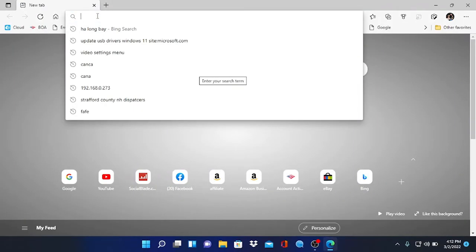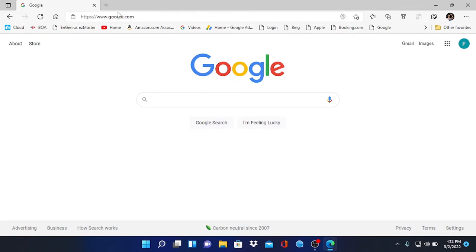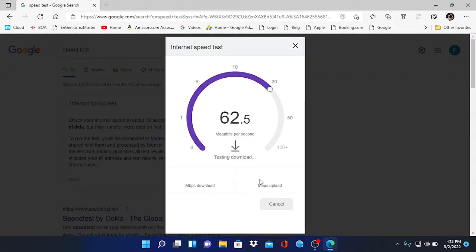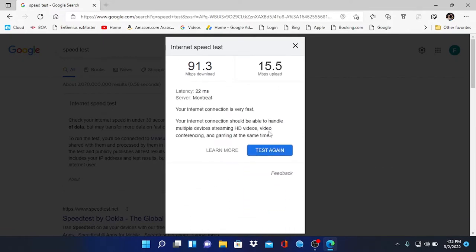We're going to do a speed test to see what we're getting. We're at the office and unfortunately we only get 100 Mbps here, but we should be seeing a majority of that. We got just over 90 Mbps. The access point has a theoretical speed of 900 Mbps, but unless you have a gigabit of bandwidth you're not going to distribute that. We're seeing 100 Mbps download and 20 Mbps upload, and we're doing pretty well with that.